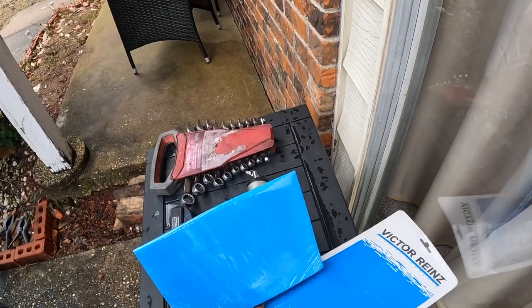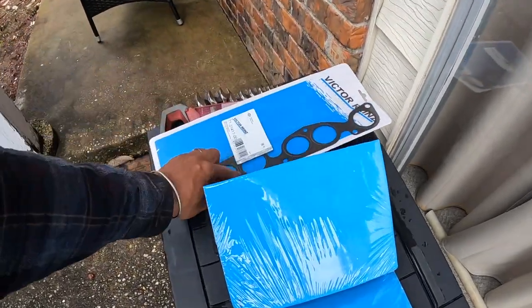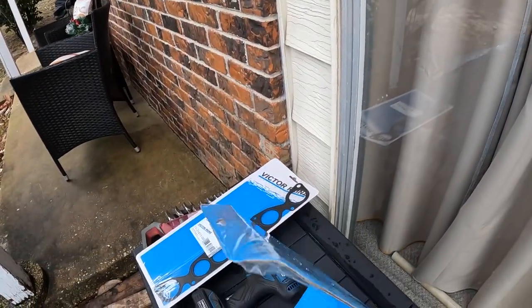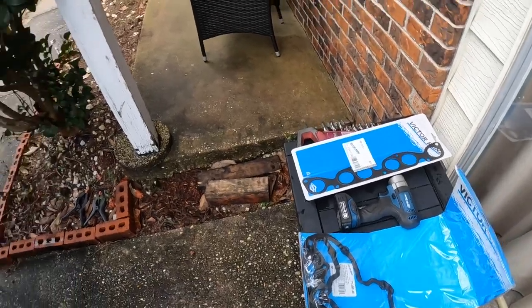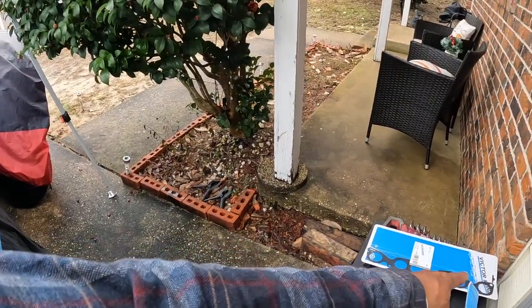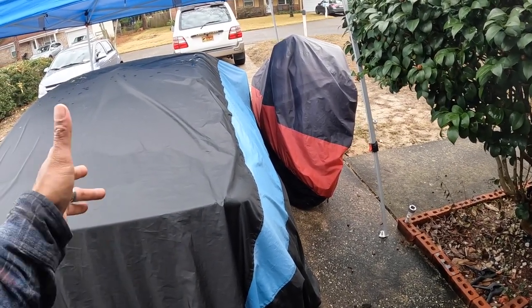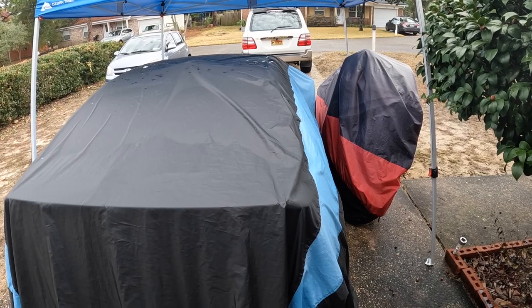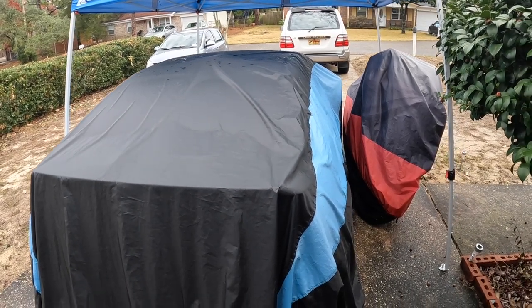So I got the upper intake gasket here. That's the metal one. And the brand new valve cover gasket. Both parts are from Eurotuning, so we're gonna tackle that, because I have a massive vacuum leak somewhere. It's gotta be the upper intake there, and we're gonna recheck and retighten the exhaust manifold a little, especially on the turbo side, the flange. That's on today's video. About a 2 hour job doing all those things, and hopefully she won't run rich and have a vacuum leak anymore. So let's get this down now.